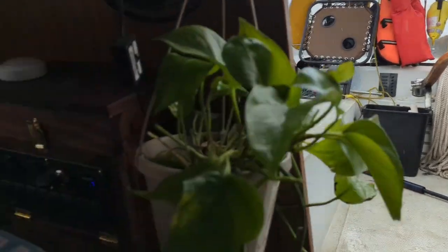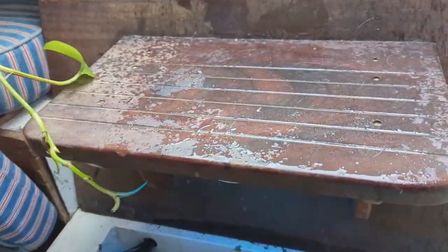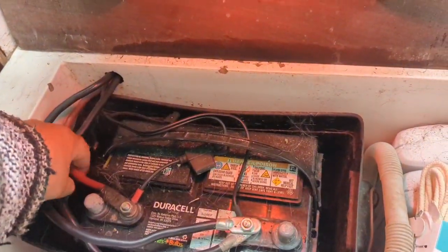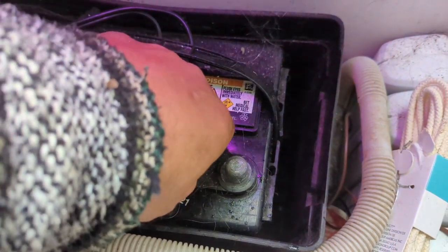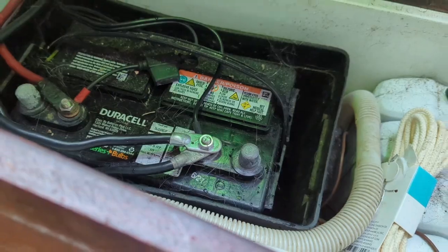It's just 13 volts right there, so I don't think it's a battery thing. I come in here to check — first thing I always check is heat. This is all warm, very warm. You see this wiggling? It might be shorting in here, so I'm going to try and tighten this up. Might just be a bad battery too, we'll see.